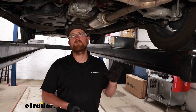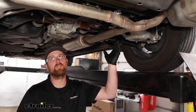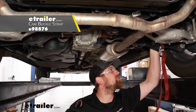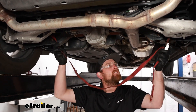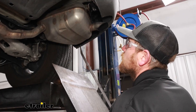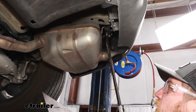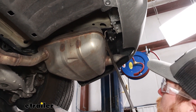To begin our installation, we're going to be underneath the back of our CR-V and we're going to need to lower the exhaust down some to give us more space to work. Prior to doing that, I like to take a strap and run it from side to side so we can control how fast and how far we let the exhaust come down. There are going to be three rubber isolator hangers we need to pop off — one right here on this muffler, the driver side is set up the exact same way, and then one more towards the front.